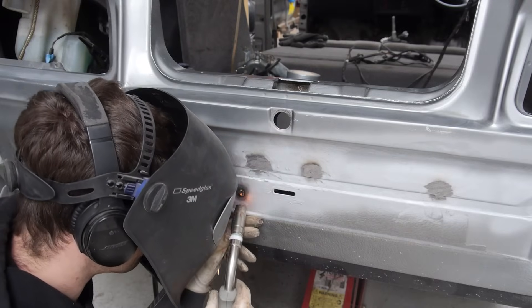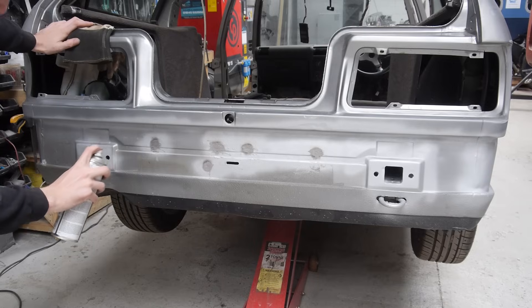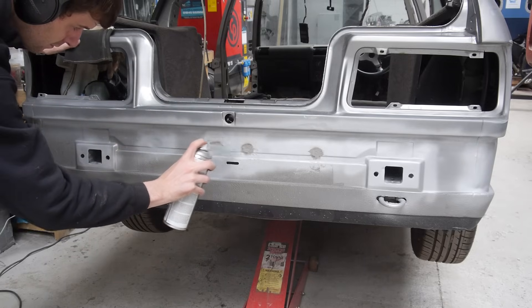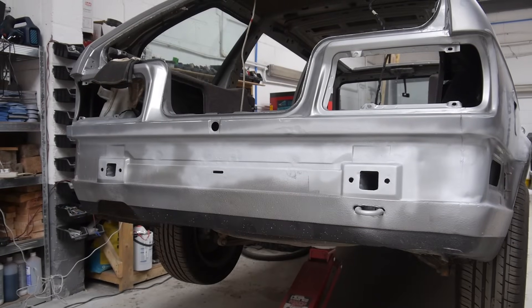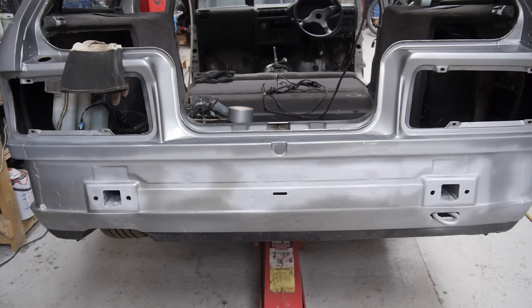With these five done, I'm going to leave this one on the inside until the new gas arrives, as it was getting really hard to weld by the last hole on the tail panel. However, this will give me the opportunity to switch to argon 5 instead of argon 15, which should only improve things. Now I can protect these repairs with primer and call that job 90% done. With a bit of filler and primer in the coming episode, it'll be like that tow bar mod never happened.